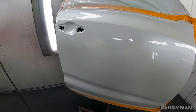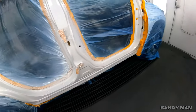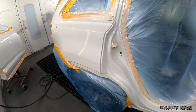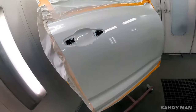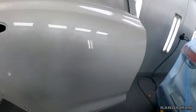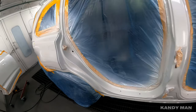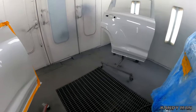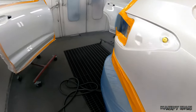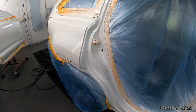The blend looks beautiful — nice and flawless. Definitely a good technique to dilute that base and get that thing blended out nice. You break up that pellet and you get a finer droplet which blends it out. Look how nice that blend is — and look at the front door, blended out perfectly. There's the new door shell we put on, and this thing is going to line up and meet up and match beautifully. This is a Highlander 070 — I'm going to put a post up early this week of this thing built so you guys can see it matches.